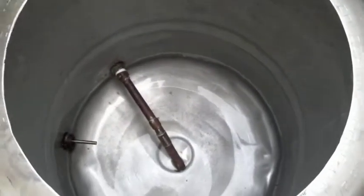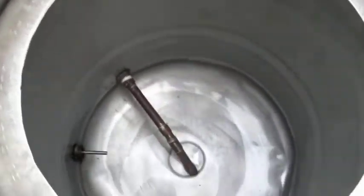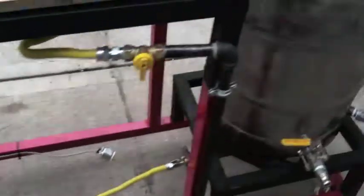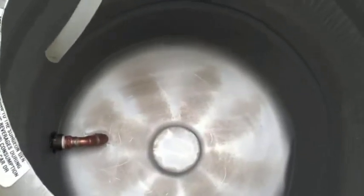Inside the kegs I built a dip tube — works pretty well. This one is for boiling and heating the water; it goes directly into the middle and works pretty good. The boil kettle has a little dip tube to the side with a side pickup that wraps around and picks up from the side. It hasn't been an issue yet since I've been using hop bags, but I just tilt it to get all the extra out since there's really no garbage left over.